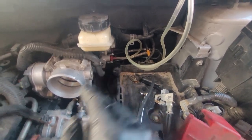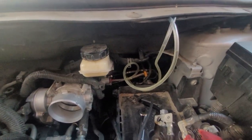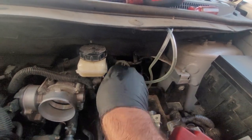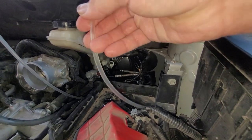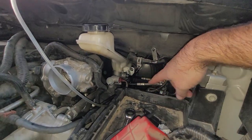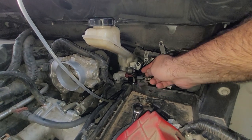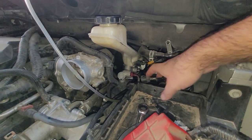I'm doing the brake lines one at a time, starting with the back one because it's harder to get to, then the front one after that. The red bleeder fitting was 5/8ths — just a hair bigger than the 15mm used for the brake lines. Before you do your second brake line, I'd recommend going ahead and plugging in your battery level sensor — the square one with the two pins — so you don't forget it. This square connector was our battery monitoring on the negative cable, which you may or may not have removed.